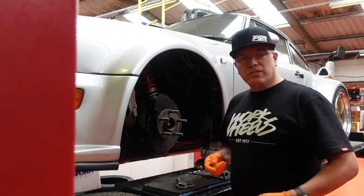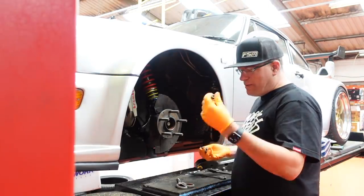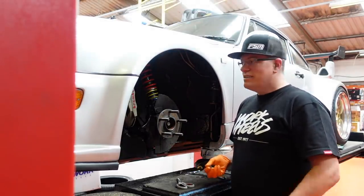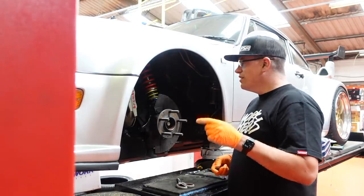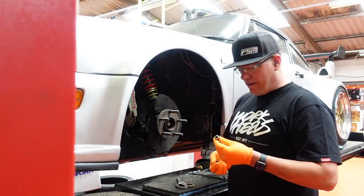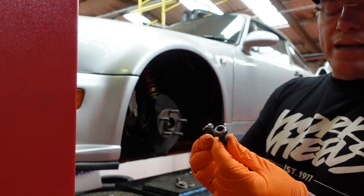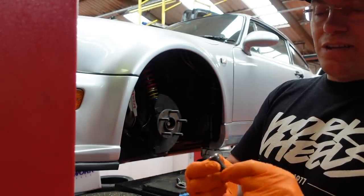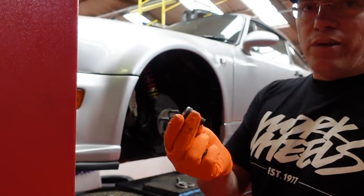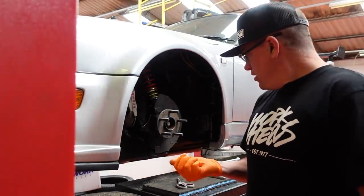So as is typical on these quick jobs that you return to after 6 weeks, it's not typical at all, is it? But yeah, this has basically been up on the ramp, cast off underneath it, and magically I'm missing a spacer, a little spacer that goes between the anti-roll bar drop link and the upright. So I've got to go and make a new one of those. And also I completely forgot that I'd made these bolts to mount the bracket to the upright, and the tolerances are extremely tight on these. And yeah, I'd only made two of them because I was only seeing whether it was going to work, so I need to make another couple of those to mount the other side as well. So off to the lathe.